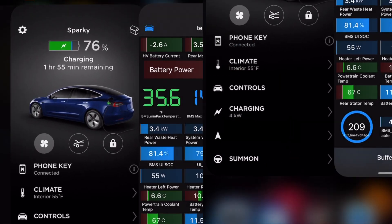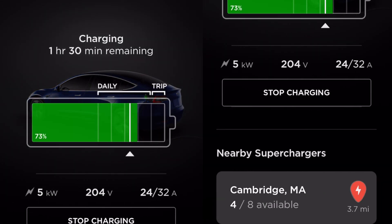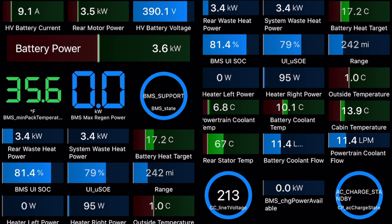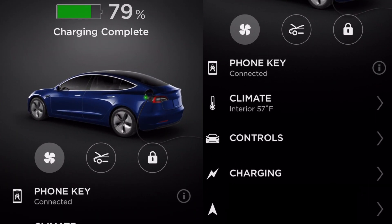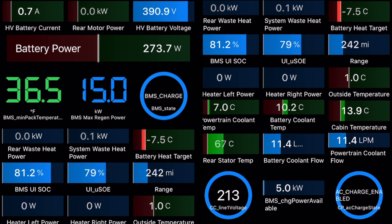I'm going to switch back over and stop charging — turn the target charge level down so it stops. Notice what happens: the motor is still running, still heating the pack. That's because I still have HVAC running — cabin preconditioning is still going. It's a nice feature: while you have cabin preconditioning it preconditions your battery, so even without charging, when you warm up the interior you warm up the battery and start getting regen. When we turn everything off, the motor turns off too and the battery is basically completely idle again.